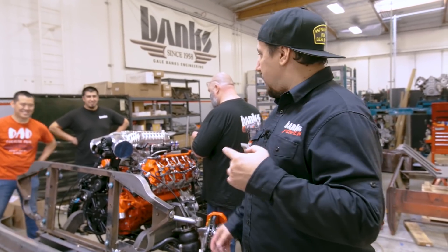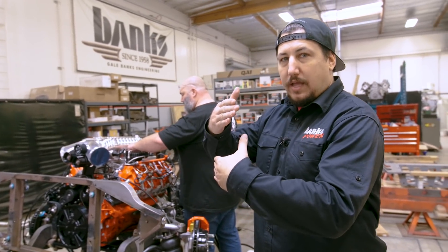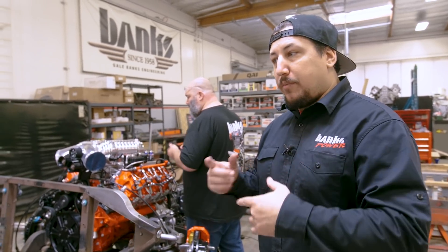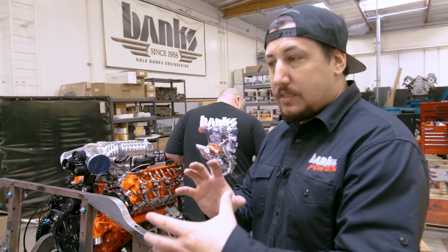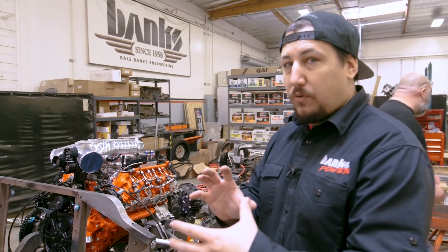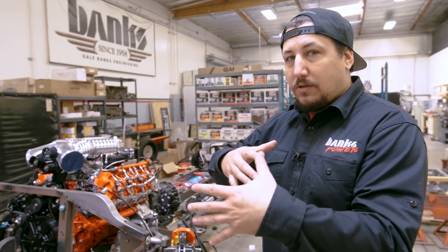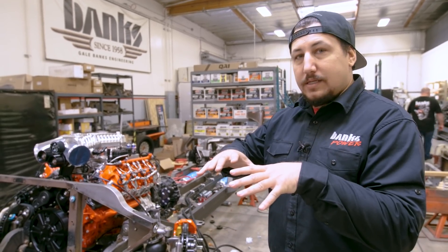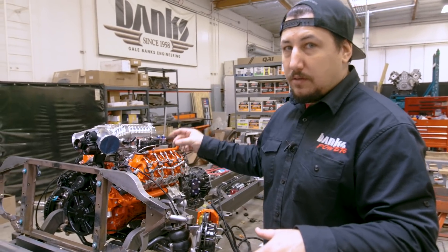Supercharger's installed. We've got some tune-up work to get it dialed in and get the belt plane to line up perfectly. We've got a procedure we've got to follow: we bring the charge air cooler back so that the face seals seal off the charge air cooler inside the manifold, then we snug down the lid, make sure the belt plane's all dialed in, tighten this thing down, and put in the rest of the fittings for our charge air cooler system.